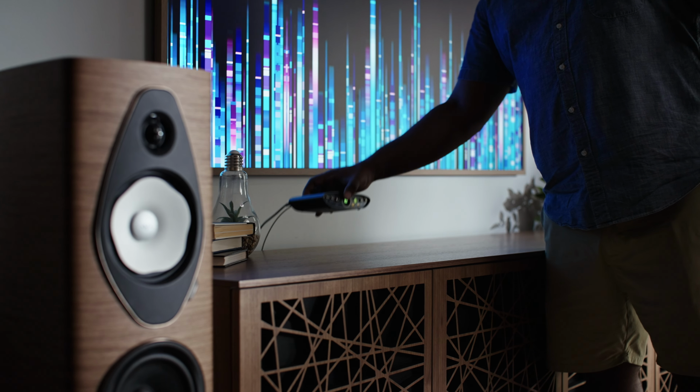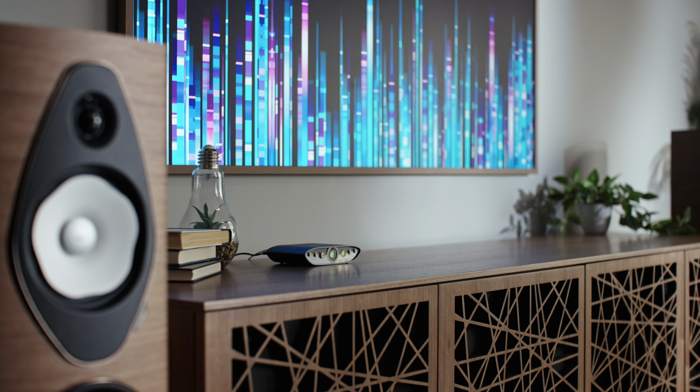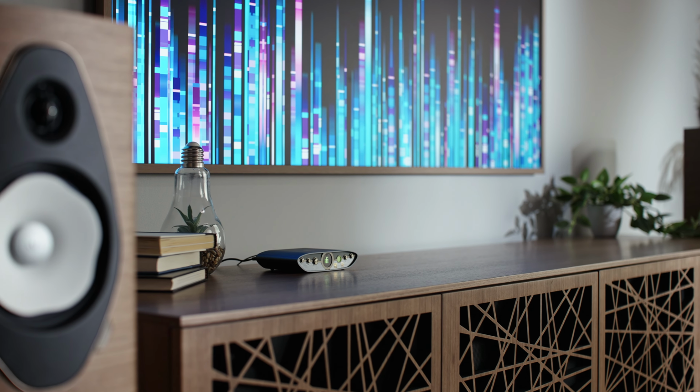And it worked. Bluetooth music through LDAC sounds a lot better than Apple's AAC codec. More spaciousness, a wider soundstage. It's subtle, but on a track you know well, it makes a real difference. The ZEN Blue 3's most exciting feature might just be that it can use the latest aptX codec called aptX Lossless. That's why you see a second sticker next to high-res audio, which reads high-res audio wireless. This is a little confusing because the two high-res are not using the same standard.